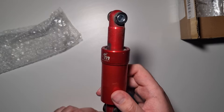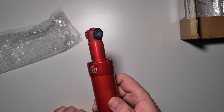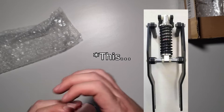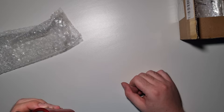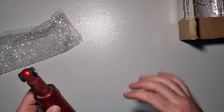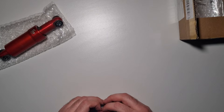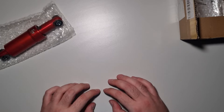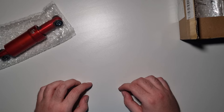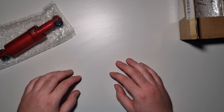The spring suspension isn't good for bigger riders. The spring ratings were roughly 70–90 kg and 90–120 kg, but honestly it doesn't work well around 100 kg. The bigger one is adjustable — you can screw it to make it stiffer — but it's really loud because there's no damper inside. So the air suspension wins. Unfortunately it's expensive, about 30 dollars per suspension, but it's worth it. I'm not showing the video of mounting the Monorim front suspension because there are already many videos showing that process much better than I can. Thanks for watching, please leave a comment and hit the subscribe button. Bye!